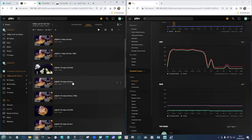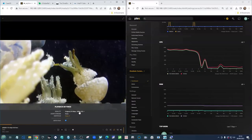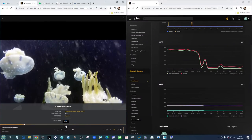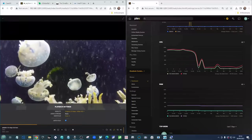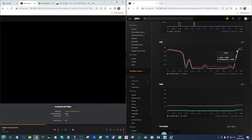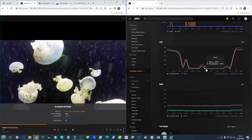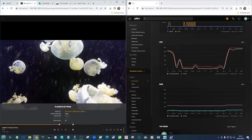Now we'll play the same 10 megabit file but this time in HEVC — this version requires that additional codec. Opening it up, we're able to play it natively and it's slightly heftier. But if we convert this file, forcing the scenario where your device doesn't support HEVC — look at that big spike on the right-hand side of the screen. It will eventually play the file, but that CPU is showing its age, particularly when it comes to a more prosumer Plex Media Server use case.